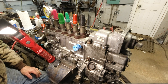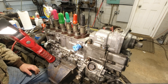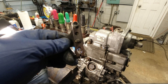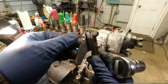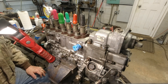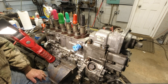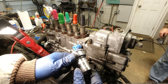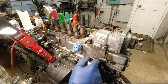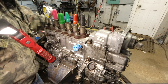We've got the pump in the vise. We've already removed the cutoff lever bracket — I'll show you here real quick so you can see it. There's one bolt right here that holds it on, and also be careful there's a keyway in the shaft right here — you can lose it easy. I've got my wrench here, this is a 22 millimeter. I'm going to carefully remove this cap so we can get in here and see the governor springs.